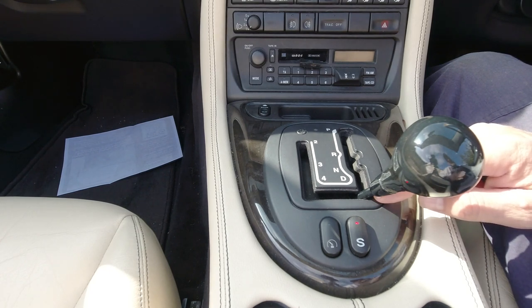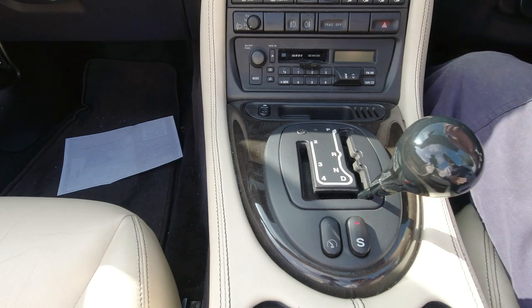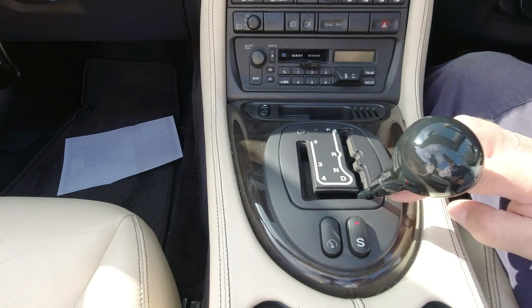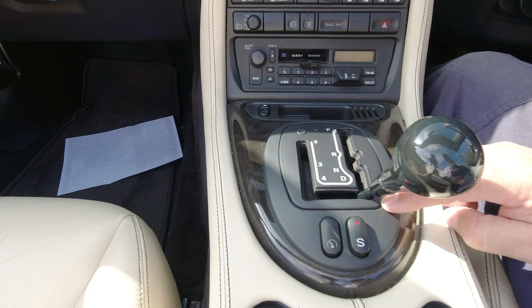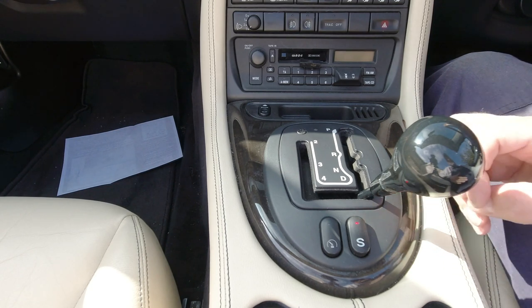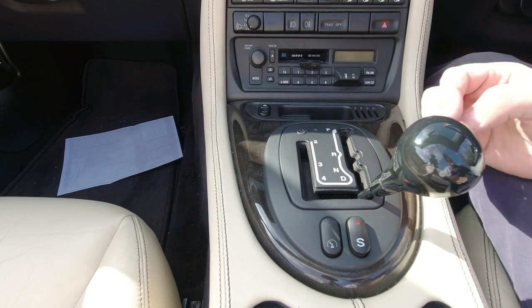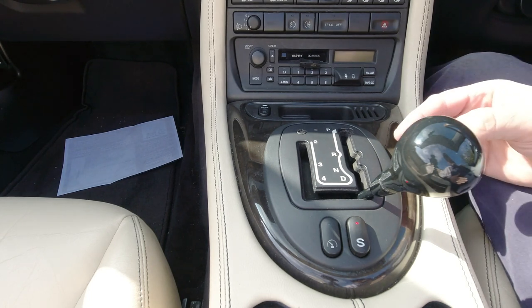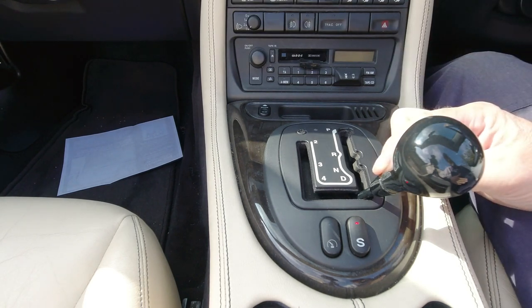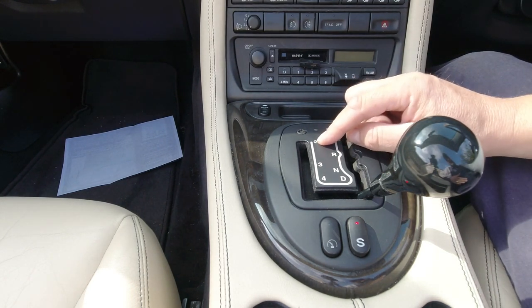As you go round the bend, you hit the gas, and even though you're going quite slowly, you want to launch out of that bend. The car is in fifth. It has to sense, oh, the throttle pedal has been depressed quite vigorously. It has to sense that it is at a particular rev and what gear it can go into. It has to change the gear. And that all adds in quite a lot of delay before the car possibly goes from fifth on entry to the bend to second because you floored the throttle.